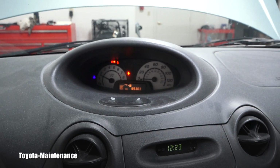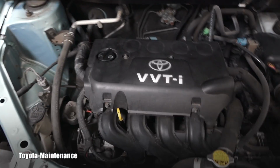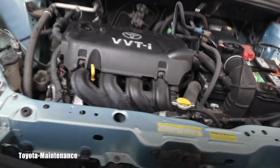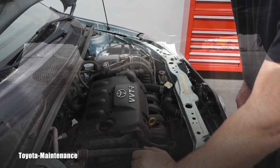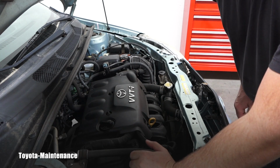That's perfect. That means there is enough pressure in the engine, right? The oil is there. I'm immediately coming outside and I'm checking here for possible leaks, and I will immediately, of course, look underneath, and I will let it run for approximately 1 minute.